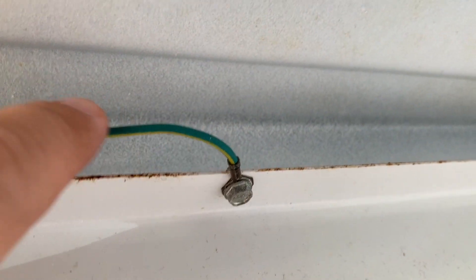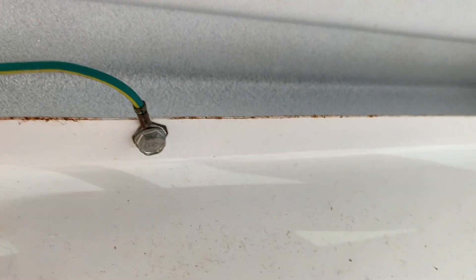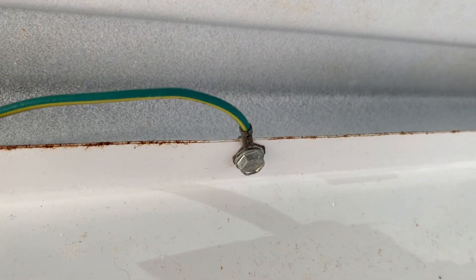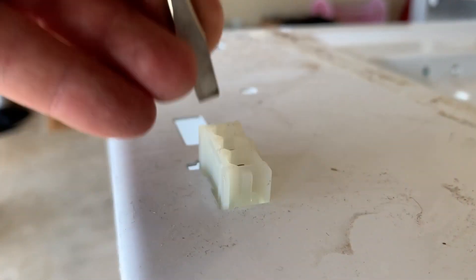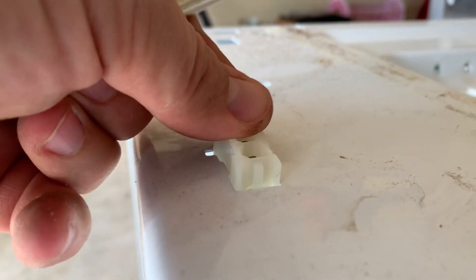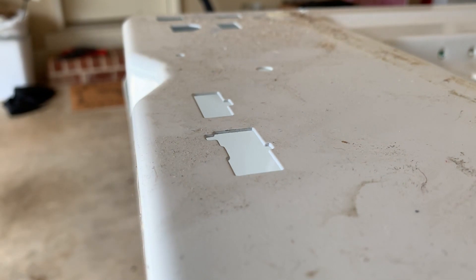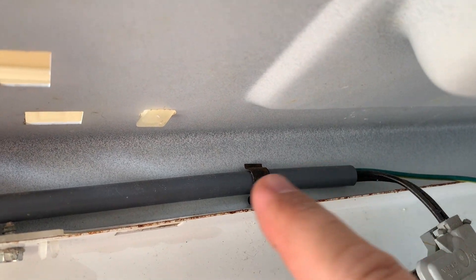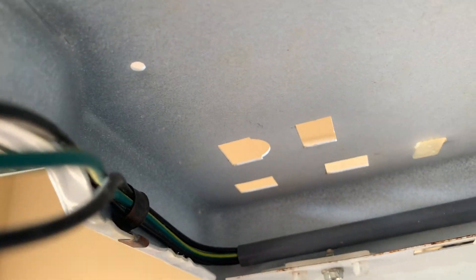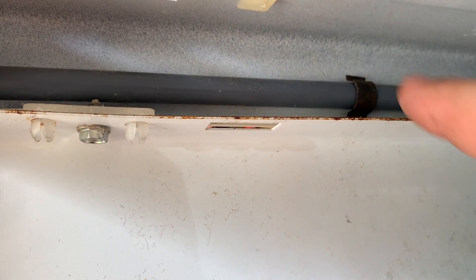Under the bottom of your unit, there'll be a green wire running to a screw — this is the ground wire, so we're going to go ahead and remove this. On my particular unit it is a five-sixteenths hex nut. Now I've got to get this pushed through, so I'm going to use a flathead screwdriver on each side to push in the tabs and it should push right through and fall through the unit. And the last things to remove it are these two clips — there's one here and one over here. I'm just going to bend it back with my finger or with a flathead screwdriver and slide this piece out.